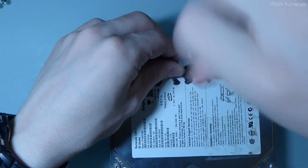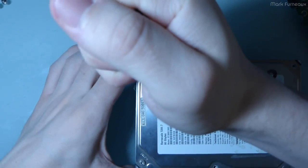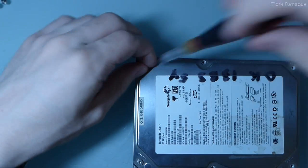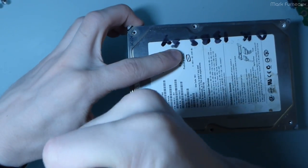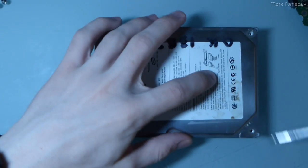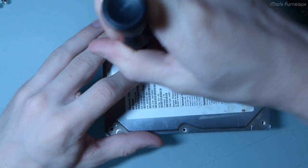That would probably be your bigger worry if you were to do this with something that's sealed really, really well. So what I would suggest is probably to include silica desiccant packets in the enclosure, and quite a large number of them. You could also use one of those reusable dehumidifier things, which is basically the same thing, but they have a hell of a lot of desiccant in them. Plus you can take them out periodically and plug them in, and they usually just have a heater in them, and they'll dry out the desiccant for you, so it's reusable.